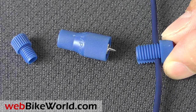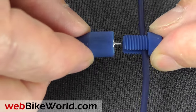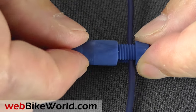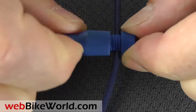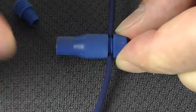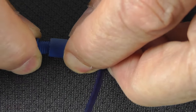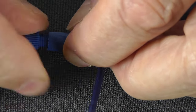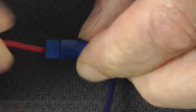Set a wire into the saddle and screw the body on. It automatically centers the tap probe into the wire to be tapped. Place the stripped wire into the collar and screw it into the body of the POSI tap, and there you have it. A tapped connection that is much easier and safer than cutting, splicing, and soldering, and again, it's reusable.